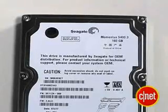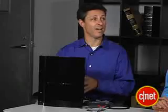So David, what kind of hard drives should we buy, and how big can we go? Well, the drives in the PS3 are right now 60 and 80 gigs, so you obviously want to go bigger than that. The one we're using today is 160 gigabytes, and you can go as high as 250 now.